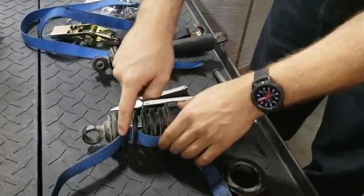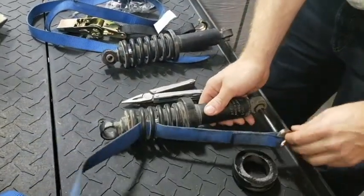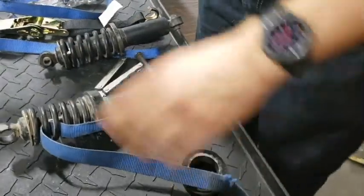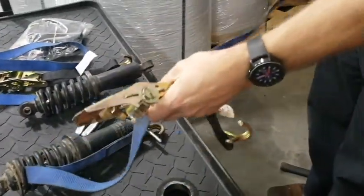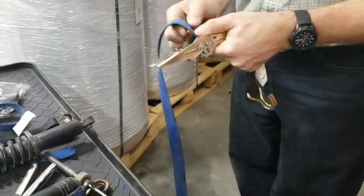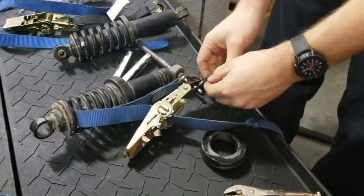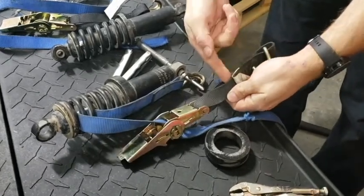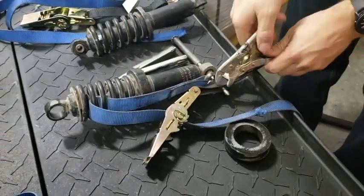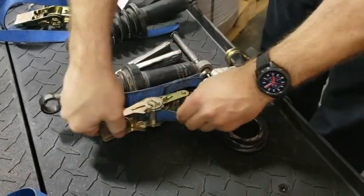Another reason why the strap works so well is that it's not going to damage the paint from painted springs. Go up as far as you can — you don't have to get the whole coil, just the top two will work. Slip this in and through the loop. We want to get as short a stroke as possible, so attach it about right there. Slip the vise grip on so nothing comes loose under pressure. This side is all ready.